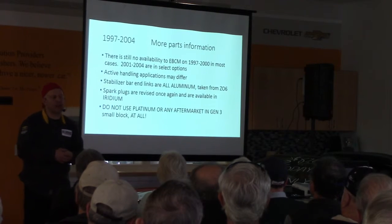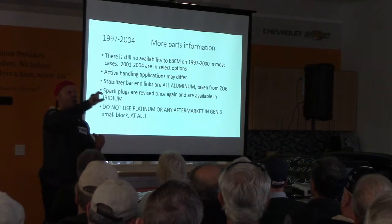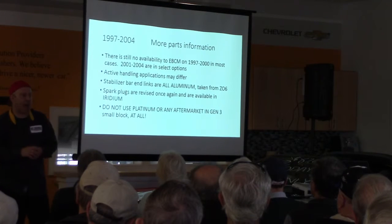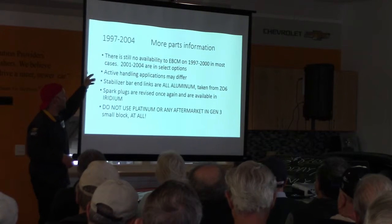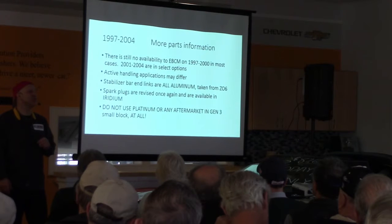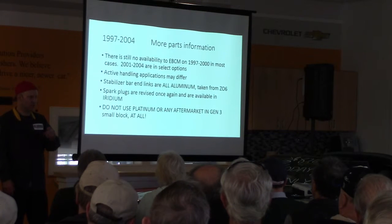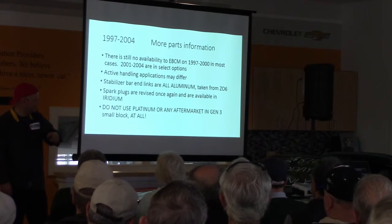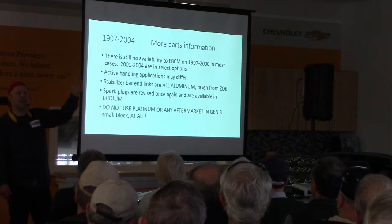What ended up happening was that 2001 to 2004 they changed the design, so there's no longer any epoxy resin. We've all heard about the C1214s and taking that power relay out and soldering a new power relay in — ABS fixers. The guy that does that — you can still do that. But remember, the diagnostic code is the key part with these ABS traction controls, because I would tell you firsthand: I fixed more by fixing battery terminal issues and connections than by replacing modules. Connections, not modules.